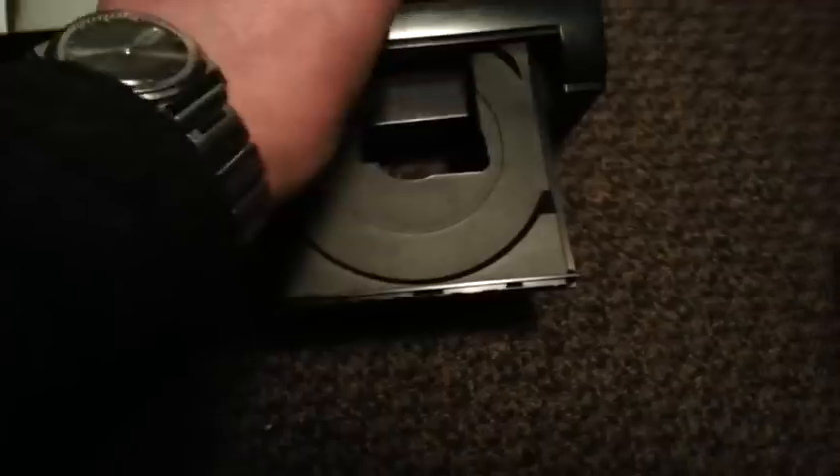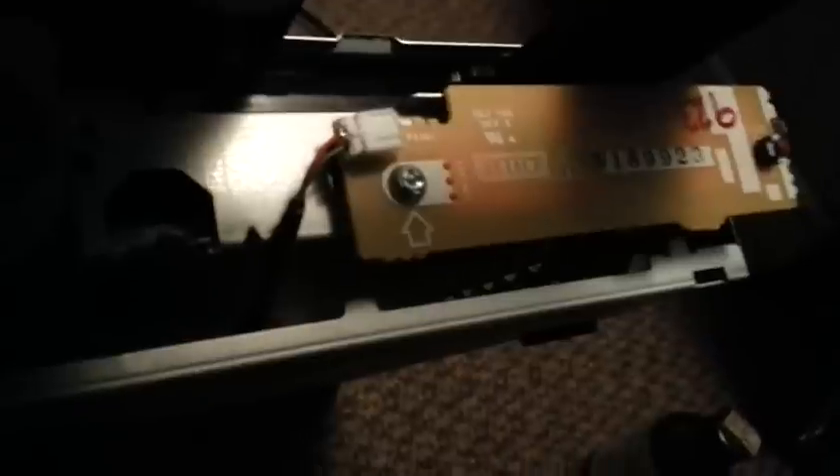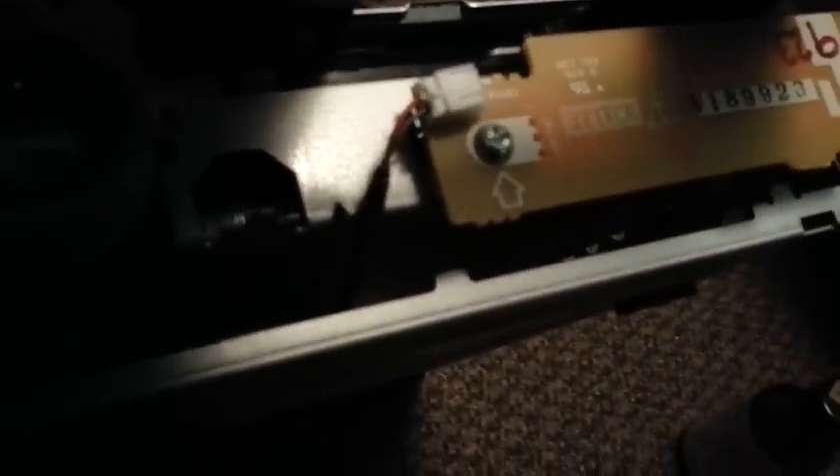I'll just whip this back off. I usually like to take just a tiny amount of contact cleaner and put a little bit in the switches. There's the on/off and there's the eject. I've got some contact cleaner in the switches — I've operated and manipulated them. If you don't have a little oiler device, spray a little bit into a rag — you end up with just a little drop on the end of your spray tube. With that little drop you just touch it into both switches, work it back and forth, and away you go.